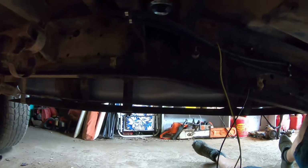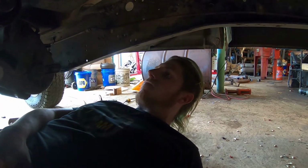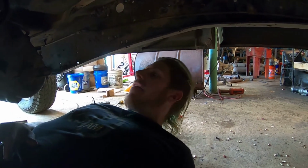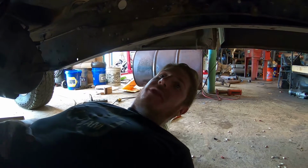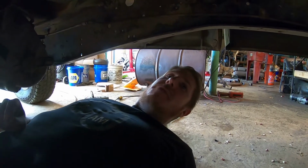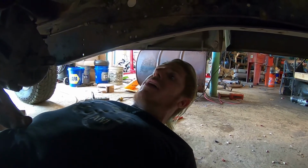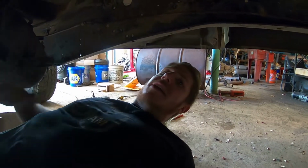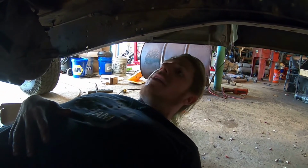So next thing I'm gonna do, I'm gonna connect the pump to a battery, pressurize the system. I did flush all of the hoses out with some old gas I had laying around after I got done cutting and putting my AN fittings on. So there shouldn't be much, if anything, left in them, but I'm still gonna power the pump up with a battery just to pressurize the system, make sure I don't have any leaks anywhere, and it should, through the pressure regulator, allow the excess pressure to come back, bleed all the air out, and flush anything extra out of the system back into the tank.